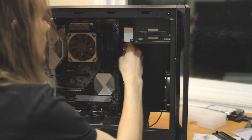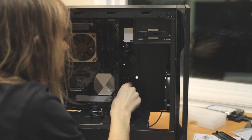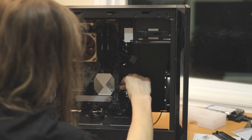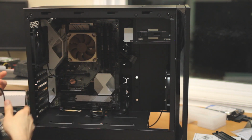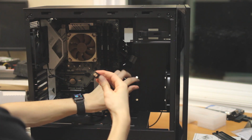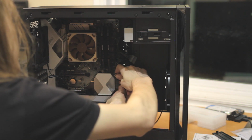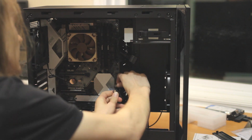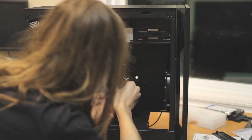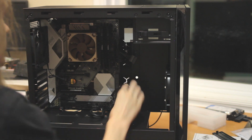Oh, these cables. They use right angle SATA cables a lot with motherboards. I have not been a personally big fan of them because they just never seem to be the right one for me. But someone must be liking them. The other thing with these new boards, due to how PCI Express stuff is laid out and this chipset, is you often get ports disabled if you use M.2s. And, well, I haven't read the motherboard manual because I'm lazy. So we'll find out. We'll see if they both show up, and if they don't, I'll move some ports around. And then hopefully they will.